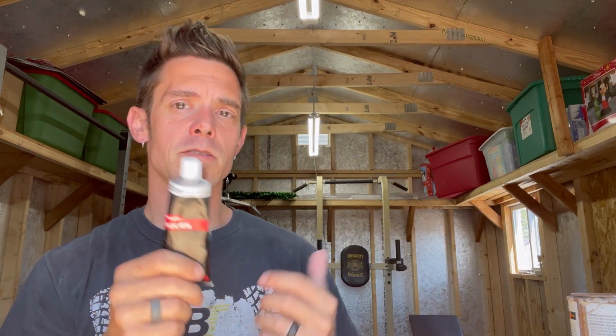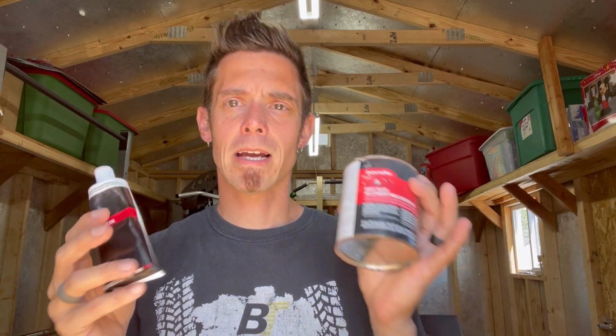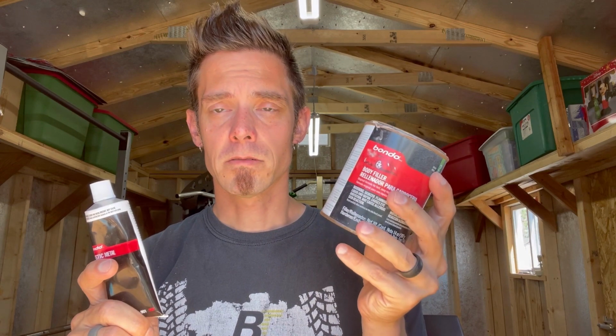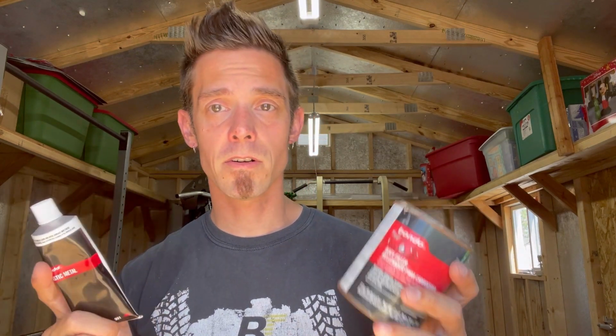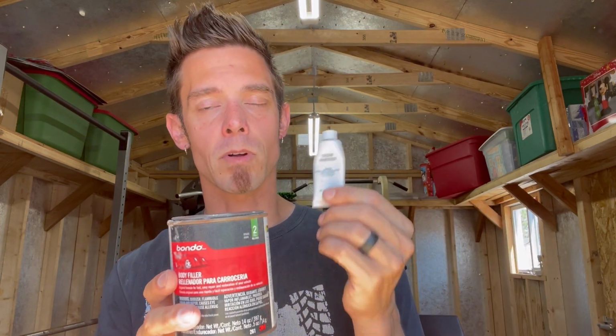So as I stated in the last video, I like to use plastic metal, and there's multiple reasons for that, okay? Now, some people might jump right into using a body filler over a plastic metal, but I'm gonna kind of explain both of these at the same time and why you should and why you shouldn't, okay? So the major difference between these two is body filler is actually a polyester resin, whereas plastic metal is actually a vinyl reinforced resin, okay? It's not a straight vinyl resin. It doesn't require a hardener, whereas polyester resin does. So when you get your body filler, it's got this cream hardener with it, okay? So it needs this. It will not work without this.